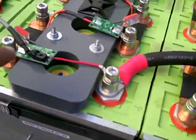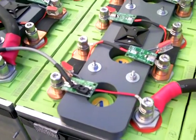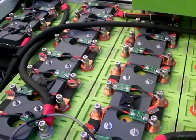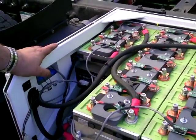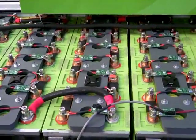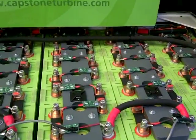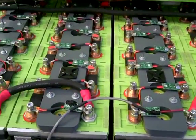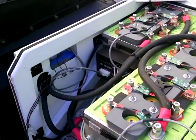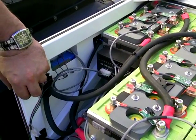And so all these little things here are to keep the battery cells equal? Yeah. It's a battery management system. When we're driving, it monitors all the cells. If there's a problem with any one of the batteries — whether it's voltage or temperature — the communication here tells the controller there's a problem, and then we can cut power back if we want to, take the load off the batteries to save them. Every battery is monitored for temperature and voltage.